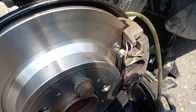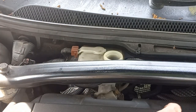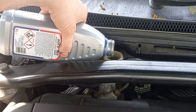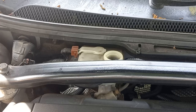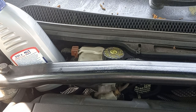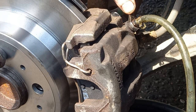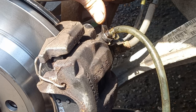Okay, on with the bleeding. It's very important that you use the right spec of brake fluid - it tells you on the cap: use only DOT 4. You don't want brake fluid that's been sitting around open for a while. I've decanted some from a new bottle into an old bottle just for convenience pouring - it's a bit of a pain if it's too full and brake fluid is poisonous. I'm just going to put the cap back on but not tight - I want that to be open, because we're going to allow gravity to do this job and gently push all the bubbles out. I've got a little spring clip on the hose to hold it tight and stop anything dribbling near our new pads or discs. I'll just crack that open and let gravity work its magic.